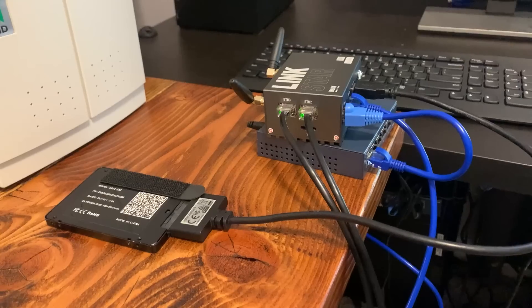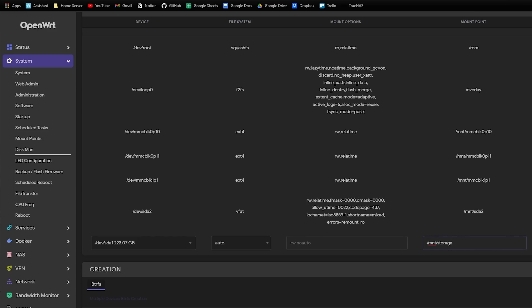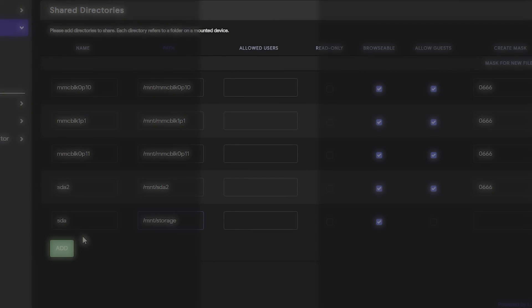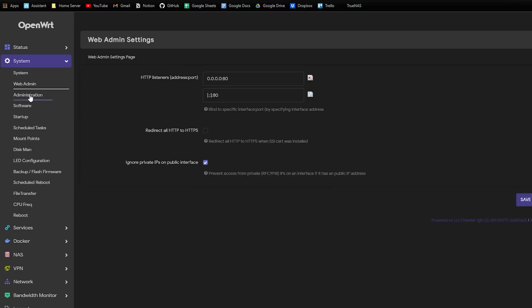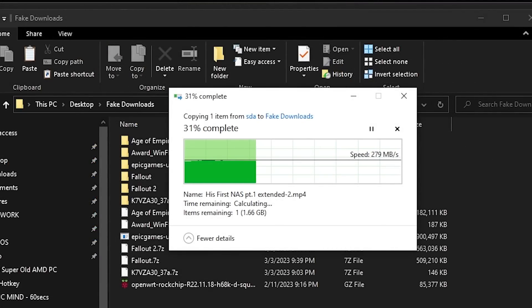Wait — SMB share? Oh yeah, this thing is capable of quite a bit more than just being a router. After adding an SSD with a USB adapter, it was very simple to set up as a really basic NAS. All I had to do was format the drive under the Disk Management tab and then set a mount point. After formatting the drive, I went to the NAS menu and set up a file share. However, I couldn't figure out how to create users or groups — I looked everywhere in the UI but couldn't find a place to create users. So I just set this up to be a public share. I'm sure there's a way to do it, and actually I do know there's a way to create users with the command line in OpenWrt, but I gotta get these videos made at some point. Once I set it all up, file sharing worked as expected, and I was even able to saturate the 2.5Gb connection.